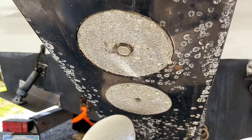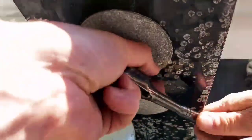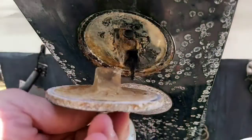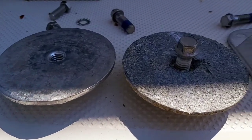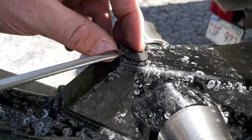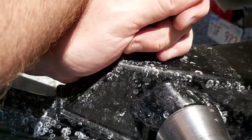The next two anodes are just above the propellers. Let's take off the back one — it's a 13mm. Let's look at the new one compared to the old one. To install this, I'm actually going to pop off this one also. To take that off, you need to pop off the little rubber cover, put an extension on with a 13mm again, and unscrew it from the top instead of the bottom.